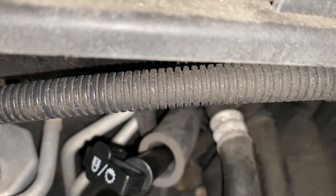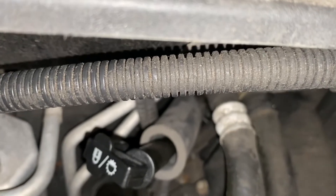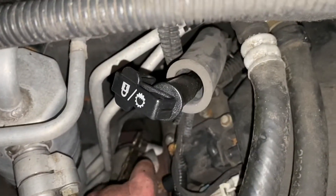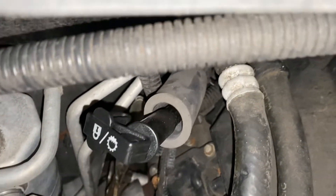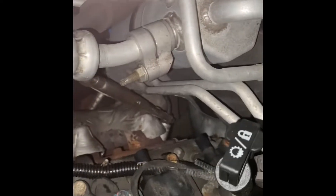If you can't get them to rotate free, they'll end up breaking on the plug. You've got to pull the metal part of the wire off the plug before you get the spark plug wrench on there. I wasn't able to do this and hold the camera at the same time.